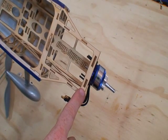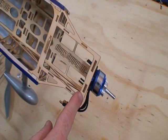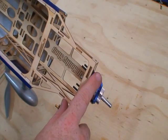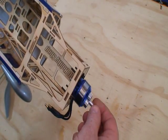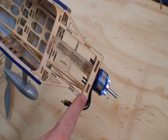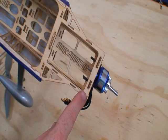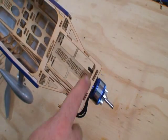You'll find right thrust on virtually every balsa aerobatic airplane in the world — a lot of sport planes and most scale planes will have it. This takes some load off your left thumb in flight; the airplane doesn't need as much right rudder through various maneuvers and tends to track straighter. This is exactly as designed — some people see it for the first time and think something's wrong with the airplane, but all aerobatic airplanes have it.